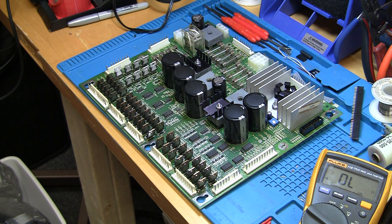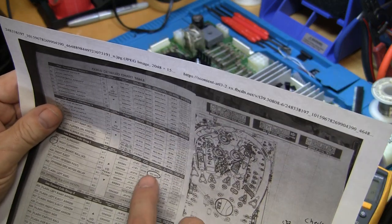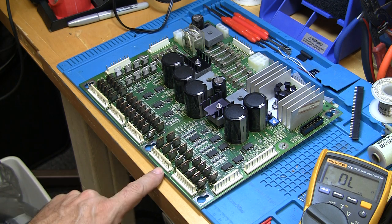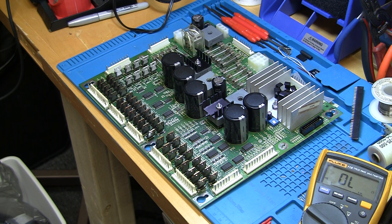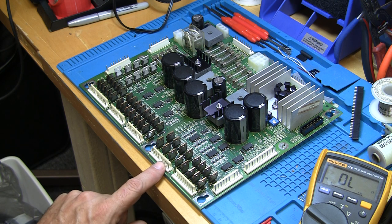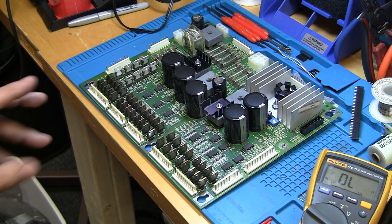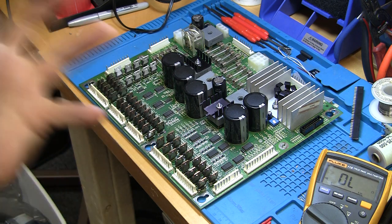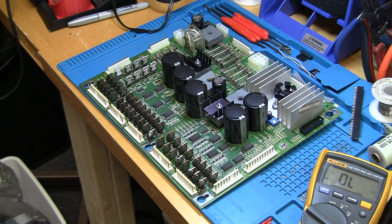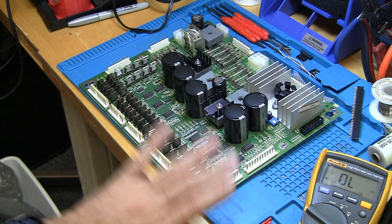Now I've got to go back and look at the wiring in the game. Pin 3, according to the coil list, is a violet wire with a red stripe. I'm going to test resistance from here on the board to the coil. If I don't get continuity there, then that's our problem — somewhere this wire is broken. I can follow the wiring harness and try to find where the wire might be pinched or broken. Worst case scenario, I could run a new wire just for this.